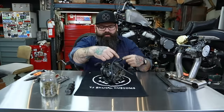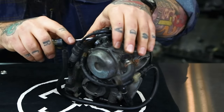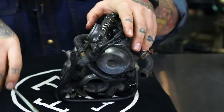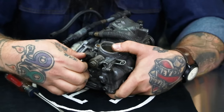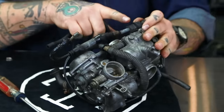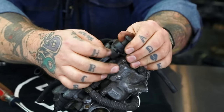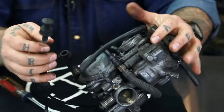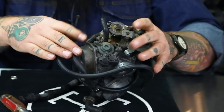The first thing we're going to do is get rid of all the hoses and the choke cable. We're going to pull this guy off. This little rubber sleeve fits on here and this piece gets unscrewed. You can use your fingers to unthread that. There's one cable choke — this is where your choke is being held. There's a little retainer plate right there. You just unscrew that, rotate this, and it comes right out. Other side of the choke — same process over here.